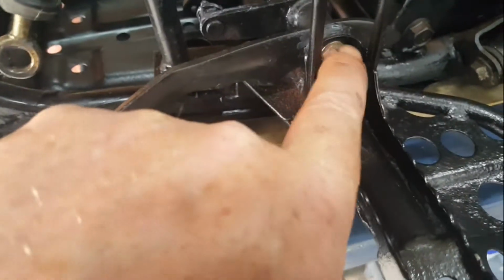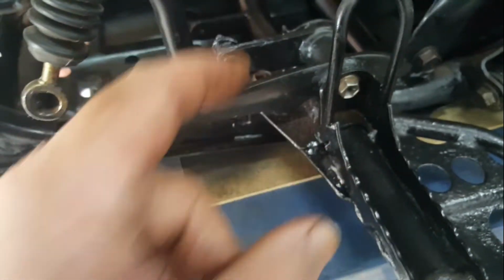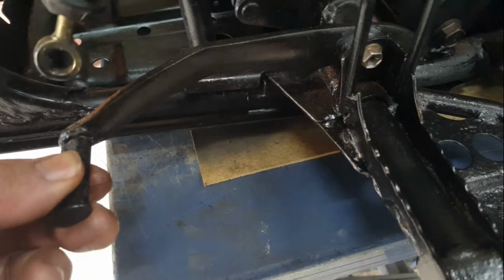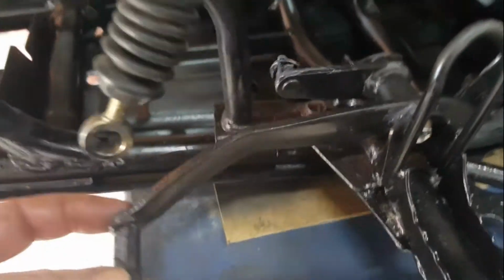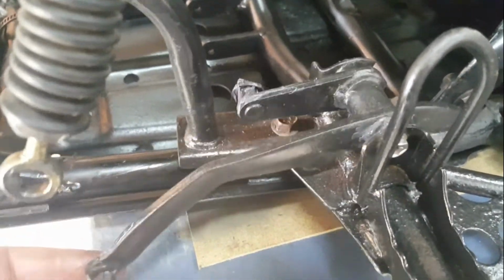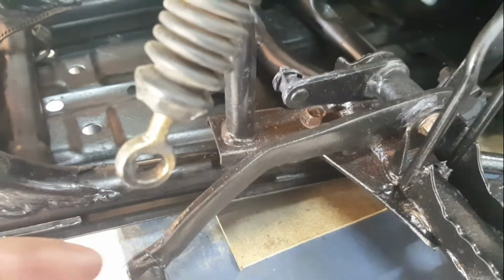Okay, with that bolt back in there and tight, it pulls those two brackets together and tight against that pin. The pin stays stationary, as I mentioned, and then that lever has got no side play and it feels smooth as. It might be riding on those new O-rings a little bit, doesn't really matter. That feels brilliant now, and no noise, no clatter, should be perfect.